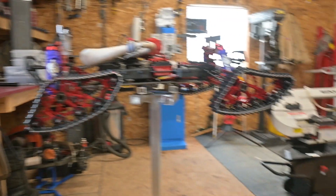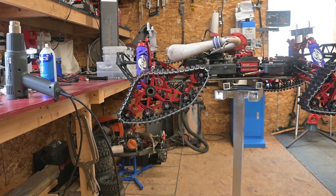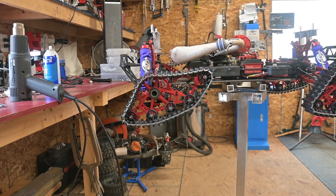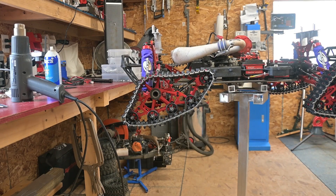The fronts aren't too bad — they sit fairly flat, but they don't oscillate. So I've got two issues with the tracks on the way they mount. Number one is on the rears, they just sit pitched way too high, and then on all four tracks — fronts and backs — they don't oscillate. There's basically no movement in those anti-rotation shocks.